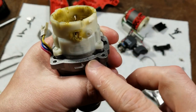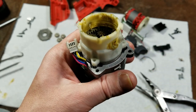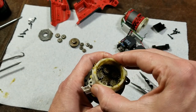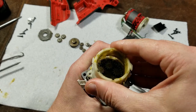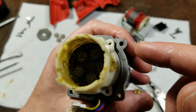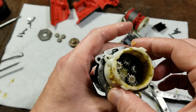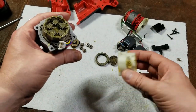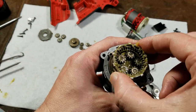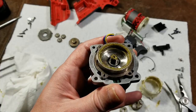The cast metal parts just support the bearings for the spindle, and then the nylon housing — the reason it's white is they don't even need to spend money dyeing it. It's really just holding all the steel parts. Seeing the other five gears in there, we can see the Milwaukee has a 13-gear gearbox, which is pretty righteous. You want to make sure you have the pieces oriented correctly since there are two provisions for the shift collar — the shift collar faces the top of the gearbox. The nylon is preventing the ring gears from spinning, which is why there are all those slots in there.